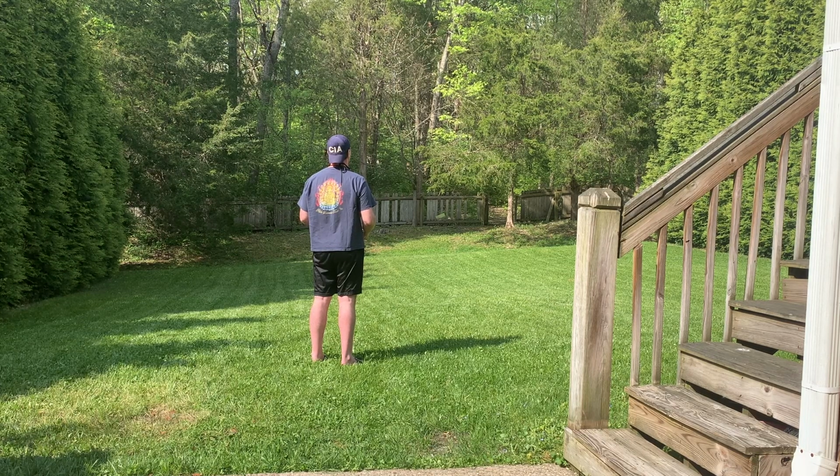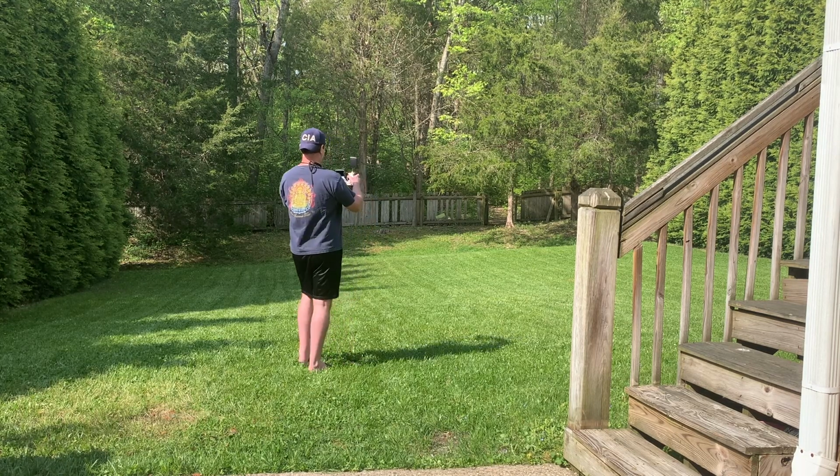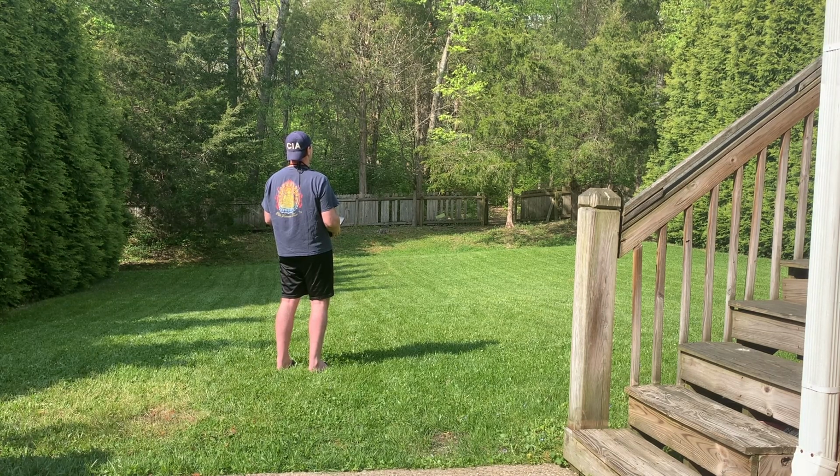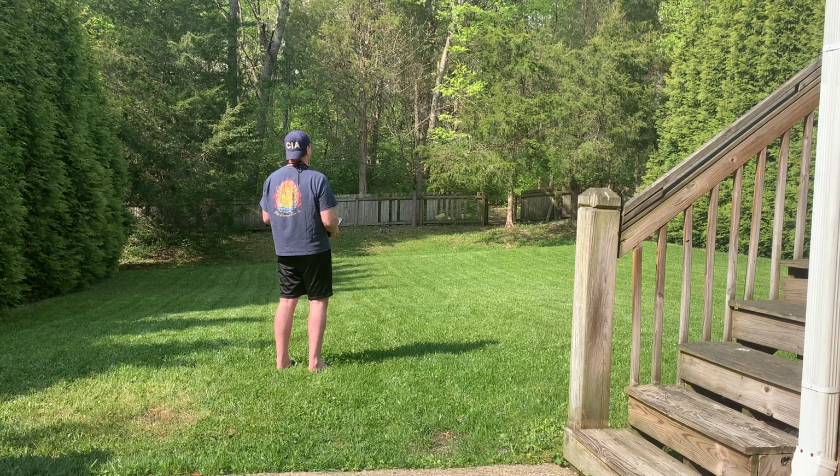So I also want to mention that they don't make the battery packs for this drone anymore, and the batteries are like 6 or 8 years old. I just haven't been using this thing. I'm so busy, and it's been difficult to get this drone running. It's been sitting on a shelf. So the battery pack actually looks like it's swollen to me now. Now that I've been recharging it and flying it again, it was really hot and it looks like it's swollen, like it's ready to bust.